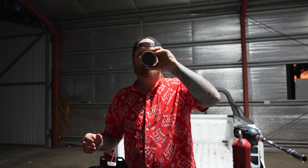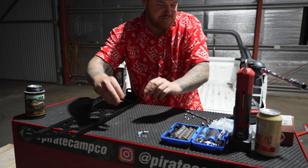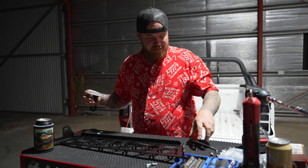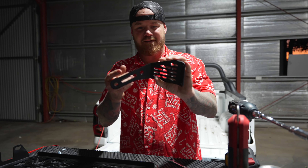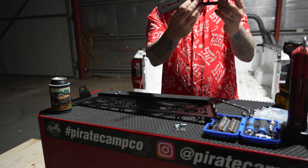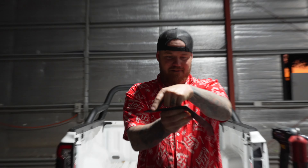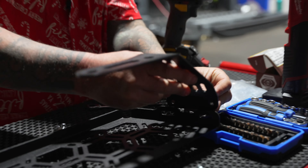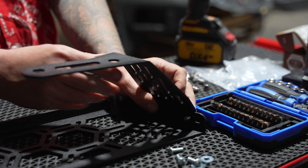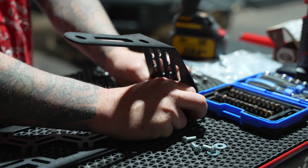Right, let's kick off the install. First things first — you're gonna get a couple of bolts from us: two M6 by 12mm and some dome nuts. That bracket kicks down like that — you want it so it comes across flat then kicks down. That's the right way, flat surface pointing up. The M6 by 12mm goes in the outside — put that in, put a dome nut on, get it straight and start it up.